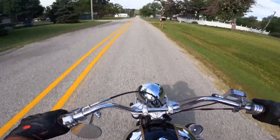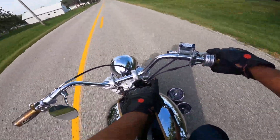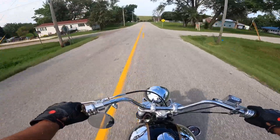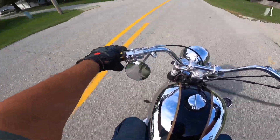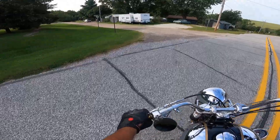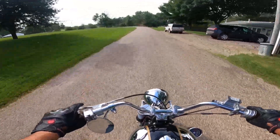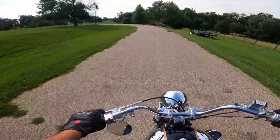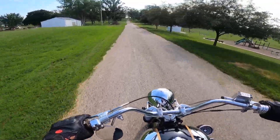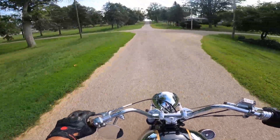Handling is a little interesting in that it's got those tall tires on it. This has a YSS suspension on the rear and progressive springs on the front with adjustable preload. So he's done a bit of work to that. I'm not sure if he's done anything to the brakes — maybe he changed the brake pads. Brakes are 320 millimeter disc on the front, floating disc with a two piston Brembo. Rear would be a 240 millimeter disc with a single piston Brembo. I like this a lot.